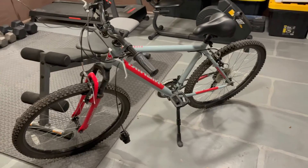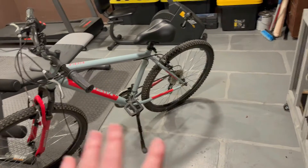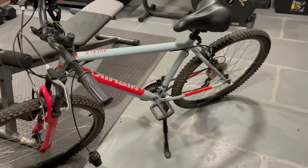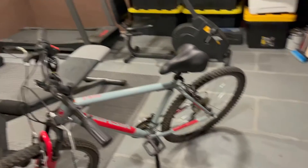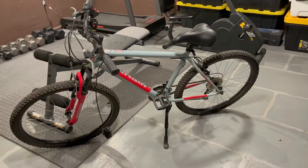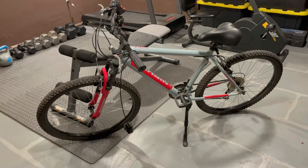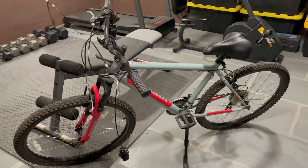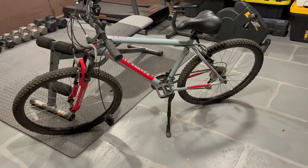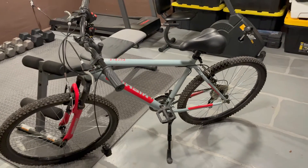This bicycle is the starting block for what I'm hoping to be a four horsepower, 3000 watt electric bicycle. The catch is I'm going to attempt to power it with drill batteries in series to make a 72 volt battery pack. I've seen a couple things online of it being done, but really not much, and that's surprising to me with how expensive lithium-ion batteries are in other forms.